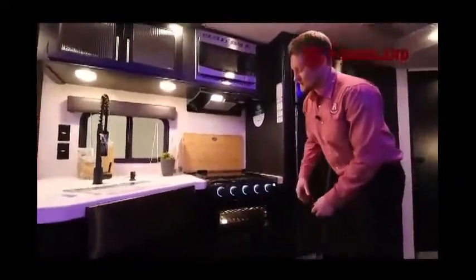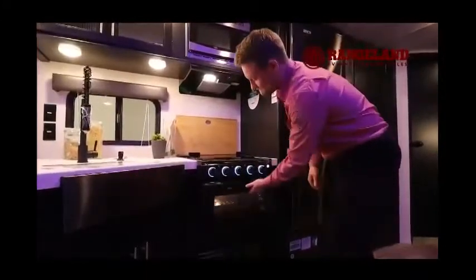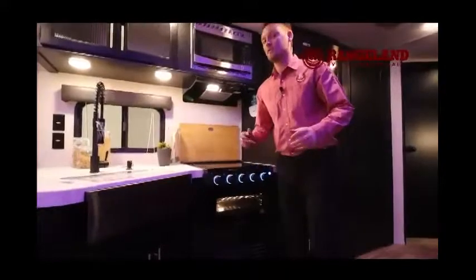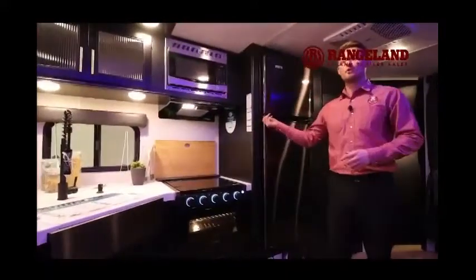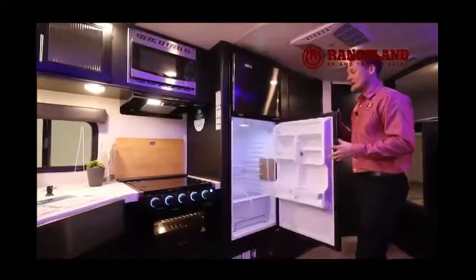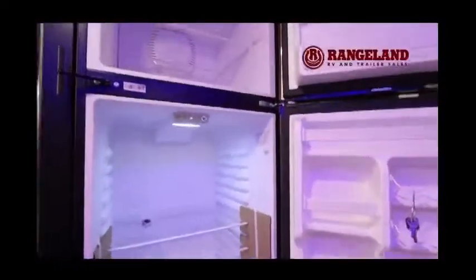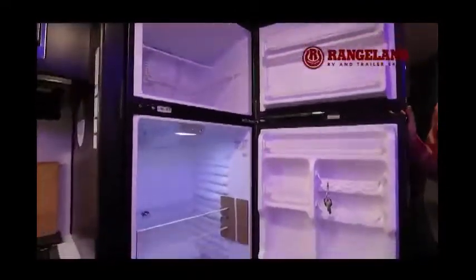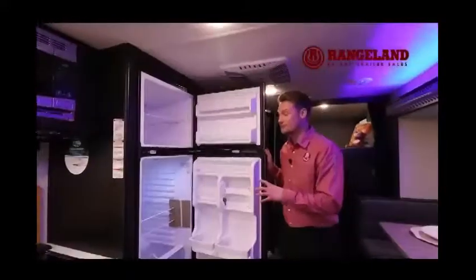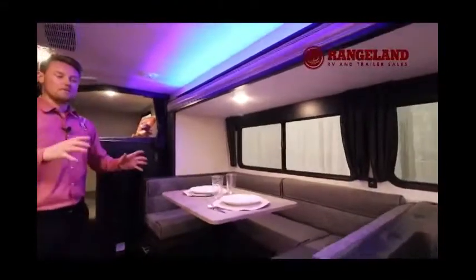Now for some of the really cool 12-volt features — Gray Wolf has gone to a full 12-volt fridge. What you'd standardly have is a 6 cubic foot fridge, but you've jumped up to 10 cubic feet. This runs completely off battery. Gray Wolf has also added what's called the Juice Pack — on top of your trailer you have a solar panel to help keep those batteries topped up while operating this fridge. For dry campers there's even a dry camp setting on the fridge, and we can help rig up extra solar panels and more batteries at the dealership.